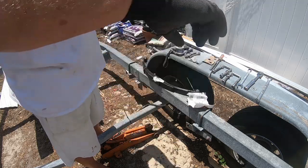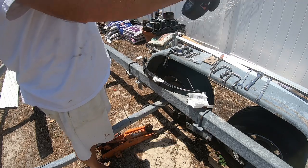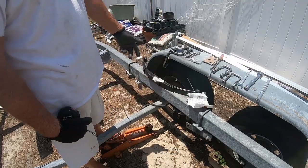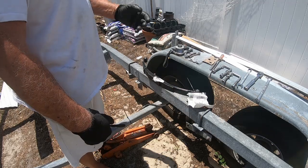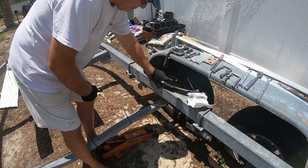So I said, well, you know, obviously the boat has been on here a long time, and maybe the spring relaxed a little bit, and if you took that arc, you'd make the arc go down this way, and that would make your 26 inches. So it's no big deal. All right, so I'll get the 25 and a quarter springs and I'll put them in. So the spring came, and I mounted it here. I mounted it over. There's U-bolts that go over the top here.